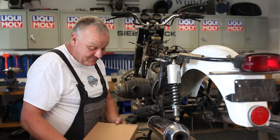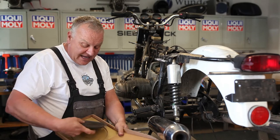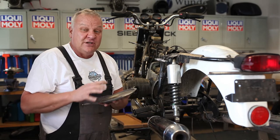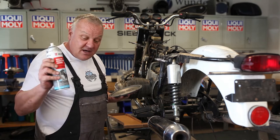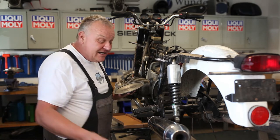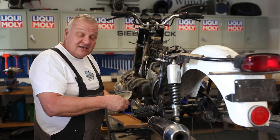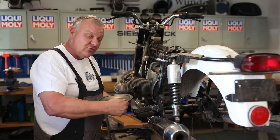Let's put the clutch in. We're going to put in new clutch pieces here, and always make sure that you thoroughly clean them with something like carburetor cleaner, electrical parts cleaner, or brake cleaner — something that leaves no residue. Just because they're new doesn't mean they're clean; they ship them with preservative oil so they don't rust.